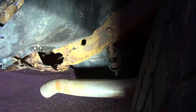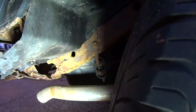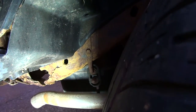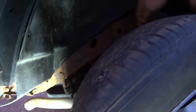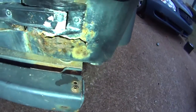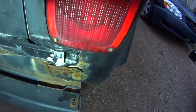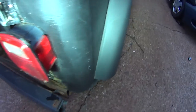The only really bad spot on the whole truck is this back piece where the bumper goes. Maybe it was sitting for a long time where the water just collected there. I'm going to have to get a repair piece for this rear right up here where that's gone. But the other part behind the wheel, that frame is in pretty good shape. There's some rust down here on the rear which I'll have to repair with a piece of sheet, and I'm probably going to put a guard over the back like I did the other Jeep.